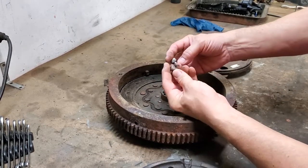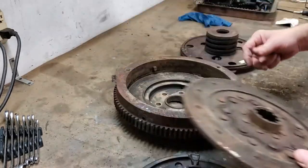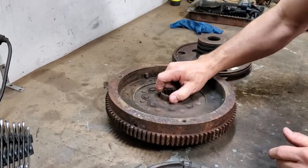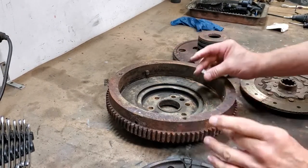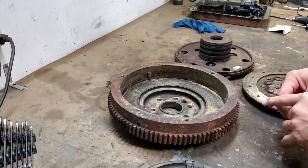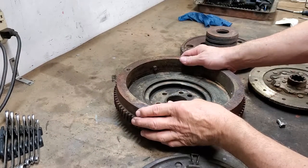These might need some help. This one's not so bad, but this one's in kind of rough shape right now. They're actually driven in, so I had to take two out to get the actual clutch plate out of here. These are obviously driven in after that's put in, and you have to have your clutch plate out — the clutch disc can't be in there when you get the nuts off to remove the flywheel. It was quite a job to get these pulled out. I couldn't get the bell housing off because the bell housing is behind this particular flywheel, so it was quite a conundrum to disassemble it. And since the engine wasn't turning, you couldn't line up the pins in the little opening in the bell housing where you could tap them out. It was a hell of a thing to get apart, but nonetheless, it's apart.